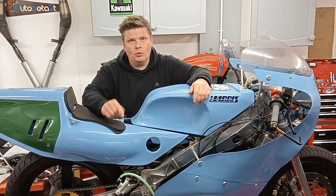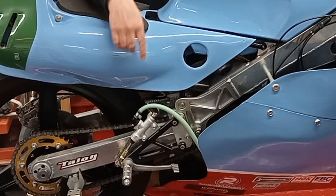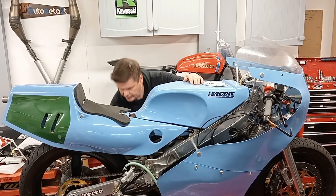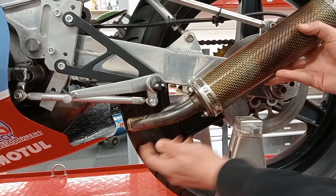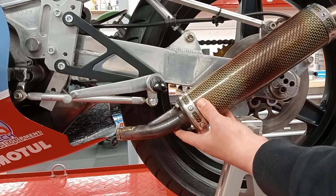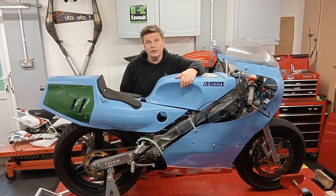The problem is my mate Andy is quite tall and he didn't fit, so he's had to have a subframe made. The seat's been moved back as you can see, and longer foot pegs have been put on. I'll bring you in in a second — you'll be able to see that this needs lengthening and the exhaust pipe, which was made originally by Phil Featherstone we believe, needs modifying. So today I'm going to be modifying the exhaust to get the silencer to fit and actually clear the swingarm.